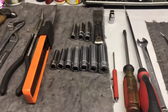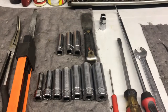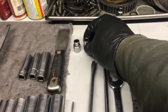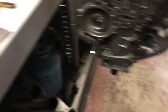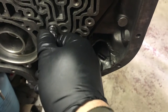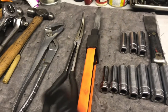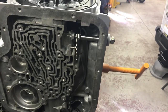You're going to need a few basic hand tools — this is a must. You need most of your standard socket set: 10mm, 13mm, and 15mm sockets should cover most external and internal bolts with the exception of the center support. For that I have a Mac Tool 12-38 short chrome and a no-name Japanese one — both fit the center support bolt and don't touch the valve body at all; they're a loose fit, no hammering required. A couple pairs of pliers are handy to get the speedometer out, maybe the nail too. A small file is needed because there will be a burr on the detent when you remove the manual linkage shaft from the case.